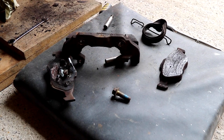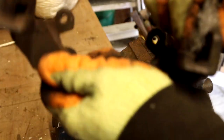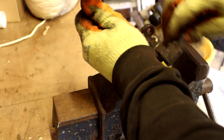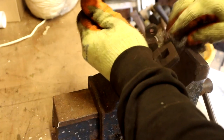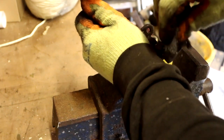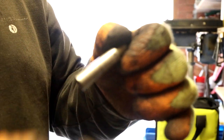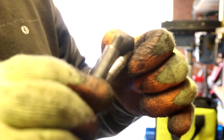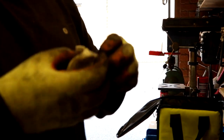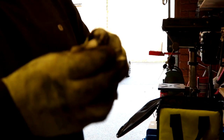These are all the parts laid out that I have to clean. Using steel wool, work in WD-40 or brake cleaner into the grooves. You'd be amazed how much road grime actually gets in these things. It's the same story with the slide pins — run your fingers up and down. They feel like a UK road surface, so they'll definitely need a wipe. Use a small spray of WD-40 and go to work. Here's before and after.